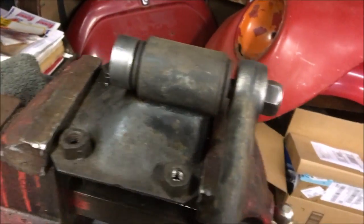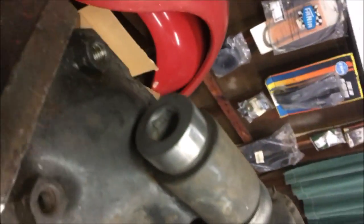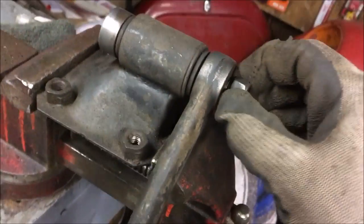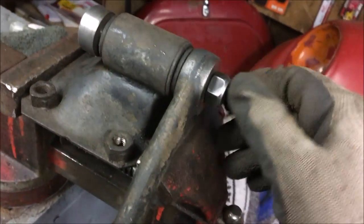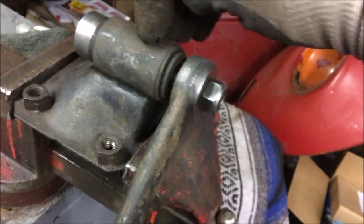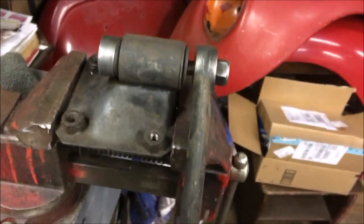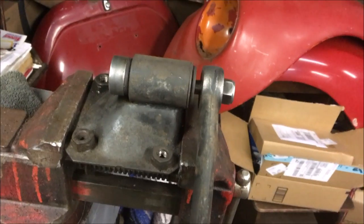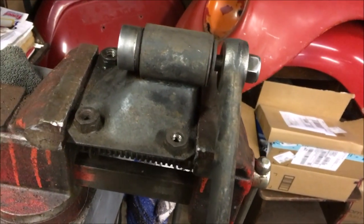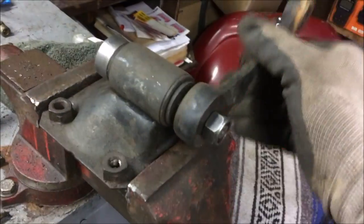Here's the idler arm — I had already taken it apart. There's an Allen head at the top. I slid the arm off and I'm going to try pressing the bushing in and out myself first, although I believe this one's pressed in a bit tougher. I've got to wait for my parts to come now. I ordered from J-Bugs, probably about a week before everything gets here. As soon as I start messing with that I'll show that process too.